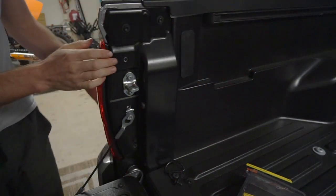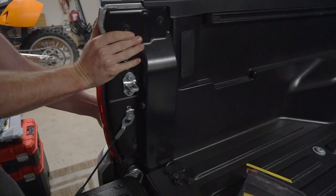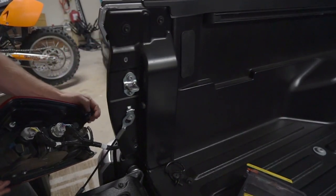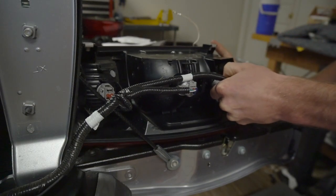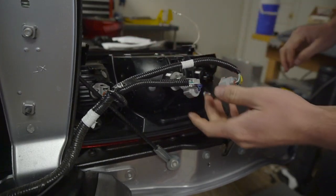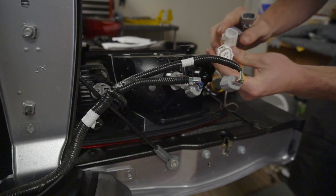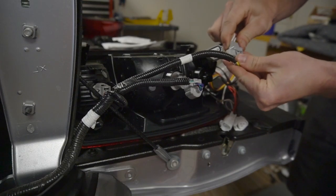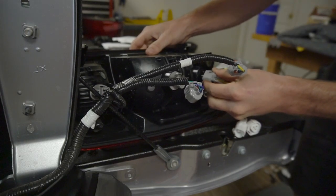There are two tabs in here holding the light. You just kind of want to wiggle it, and there we go. Now we've got the brake light completely disconnected. Go ahead and push these tabs in and pull it out, then do the same thing on the other side — pull the middle one out as well. On this side we have our two connectors. You can see one's a triangle and one's just a flat pin connector. I'm going to put the male and female together. Make sure you hear that click — there's the click. Little test pull, good to go. Then put it back in.